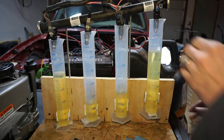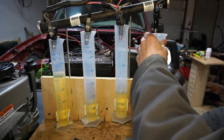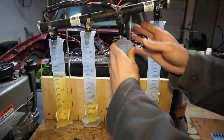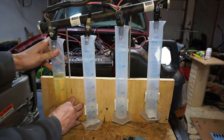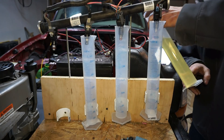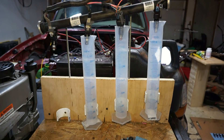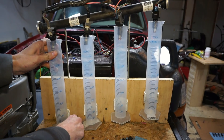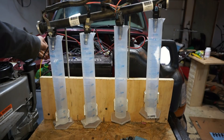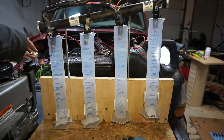Let me dump all these out and we'll do the pulse test. The pulse test is set at about 21 Hertz — that's about a 2500 RPM engine equivalent — so you get a good representation of what the injectors are doing under normal driving load conditions and wide open conditions. Turn the fuel pump on, pulse mode, let's go.